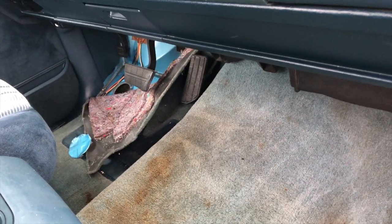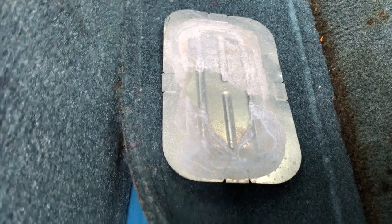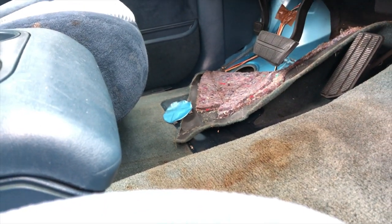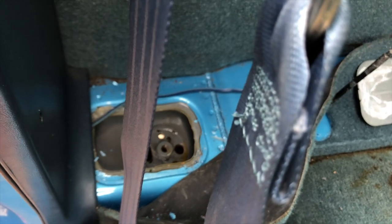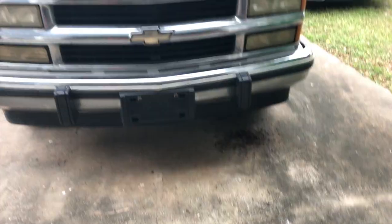Look at that thing — destroyed. Yeah, it's behind the seat here. There's one up here in the front. It's obviously got sealant around the access, so you cut that first, peel it all back, cut around where that ring is. Stick a flathead underneath and that panel will come right off. Don't try to stick a flathead underneath there first without cutting everything and pulling it out, because you're just going to ruin that panel — just like I almost did. I sprayed it with PB Blaster a couple times, let it sit, sprayed it again, then took it out.